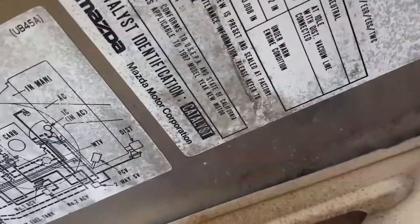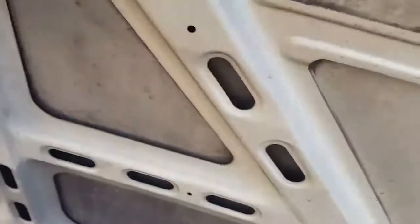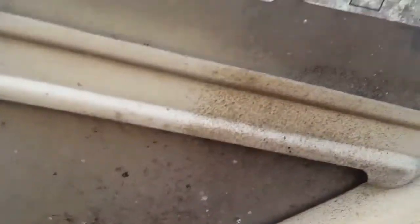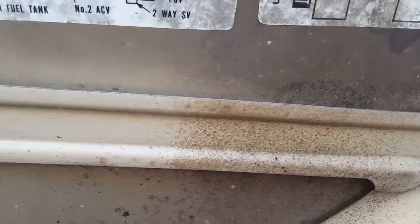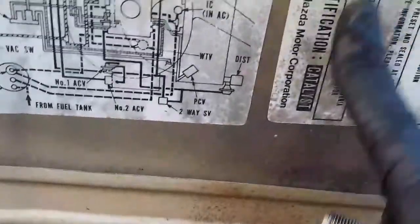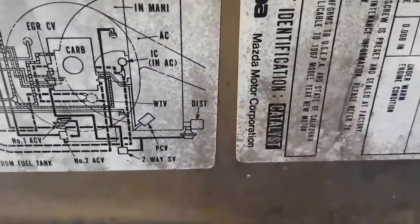Of course it gives you Mazda B2000 — it should give you the year. Here's another sticker that gives you specs on the oil for the engine, oil for transmission, the differential, the steering gear — so it gives you all the specs. I don't see anything for the spark plugs. I'm missing the sticker that tells you the spark plug gap. Anyway, this one doesn't show the spark plug gap, but it tells you the year — it's a 1987. For any older car, 45 thousandths is fine.